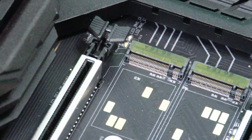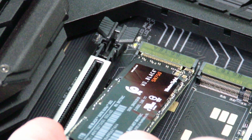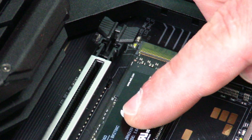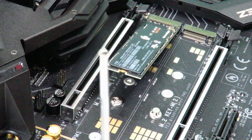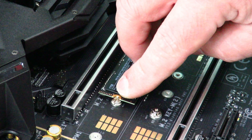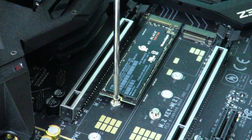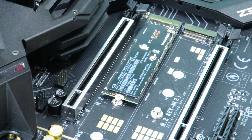Okay, so now what we're going to do is slide this guy right in there, just push it a little tiny bit, and then push it down. Once the drive's in, grab that screwdriver again, push down, and that little plate where we unscrewed the screw is going to fall in line with the end of the drive. Then just drop that little screw in and screw it down. Pretty simple, right.